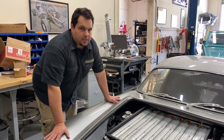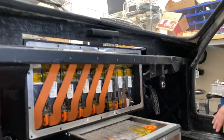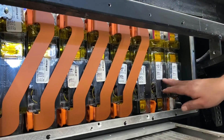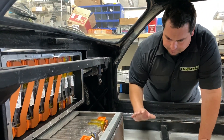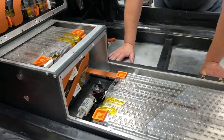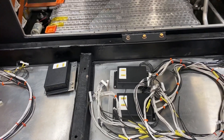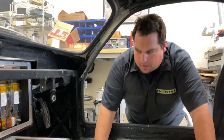Let's take a look inside the cabin. So inside here we have the other four modules below and obviously the eight right here. We did end up engineering some circuit boards so that we can transfer the cell taps to our BMS — we had to engineer and build all those as well. We have the contactor fuse in here for the positive side, and that all goes back to the rear box. We also have all the cooling in here for the lower packs, and these BMSs right here — two of them go here, one of them hangs here to connect to all those boards so that we can monitor all the cells.